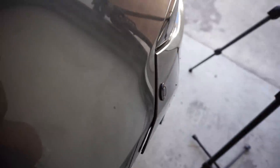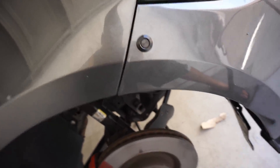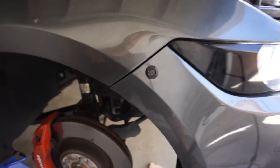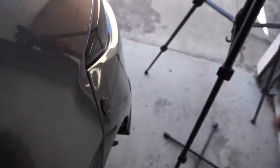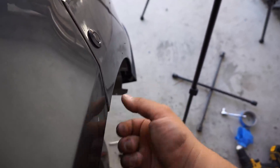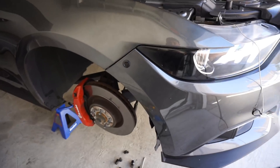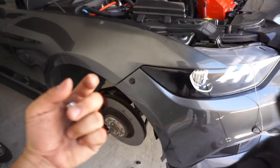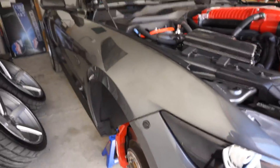It's okay — I just need to adjust it and push the interior pin in more, as you can see it's sticking out quite a bit. I'm going to push that in so it sits more flush. The gap is definitely quite a bit bigger than I would have liked, but it doesn't look too too bad — it actually kind of lines up pretty well with these gaps here. Once I align the proper height it's actually pretty flush. This is better than buying a $1700 replacement bumper. I'm going to clean up this side, put lock washers on these nuts, double-nut the back side — which means backing another nut into the existing nut to keep it from backing off — and put some loctite all over this.